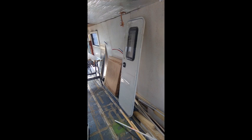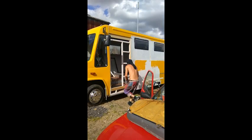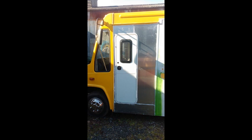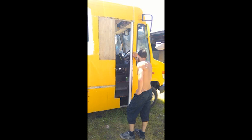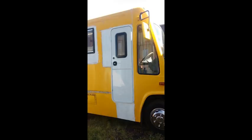For the doors, we settled on these caravan-style doors because we couldn't find any truck doors anywhere. I had to figure out how to put these doors in that hole, so I just trimmed out, put wood to the size of the door as close as I could so it'd fit in. Then I had to put more metal on - got the scaffold boards back out, more goop, and there we go, the door was in. The other side wasn't supposed to have a door in, but my 9-inch angle grinder said there was going to be a door in that side - and I found a step as well, so it was destiny. More trimming out, more bits of wood, more gluing metal, door in, screwed in, gooped in. That was pretty much the bodywork externally sorted.